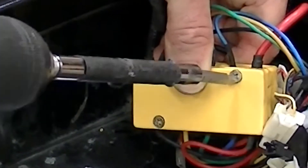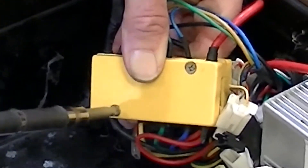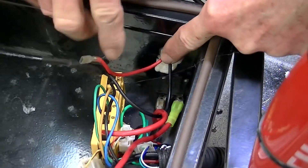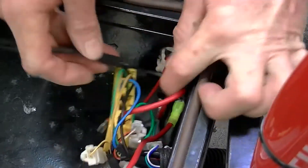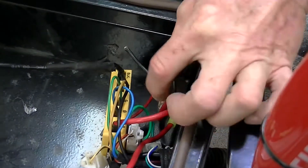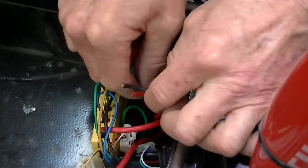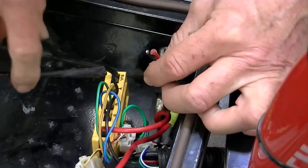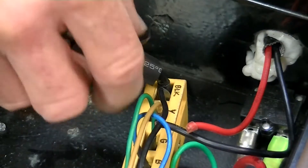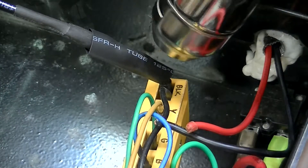Replace the cover on the bus box. Here's the red wire to the charging port that was connected to the fuse holder removed earlier. Cut the small gauge black wire leading to the charging port at the point where it spliced into the main black battery connection cable leading from the bus box. To prevent any possibility of an electrical short, I covered the exposed stub where the black charging port wire was spliced into the main black battery cable with some heat shrink insulation.